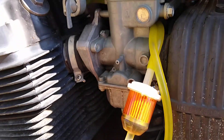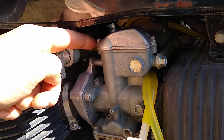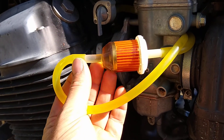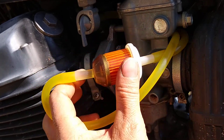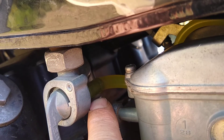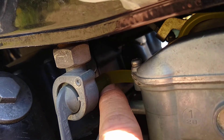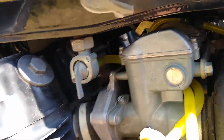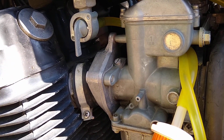To stop the blockages, I put in this inline fuel filter. It's ugly and doesn't quite fit here — I tried to put it behind the first carburetor in that space, which fits perfectly, except the connectors on each end are an inch and a half long. I couldn't handle the 90-degree turn because it would kink the hose.